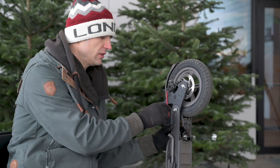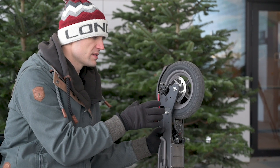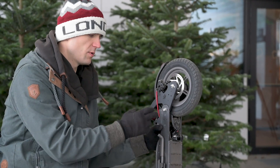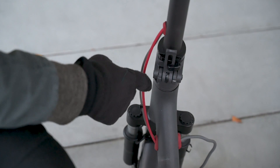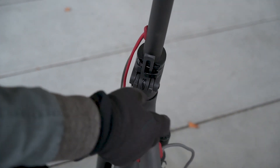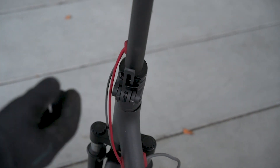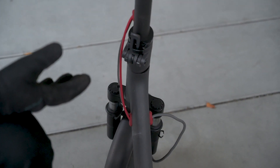Another downside — I don't like how this cable is now. While I made the rear brakes work and nothing is touching, I feel that this cable is really stretched both here and at the front of the scooter. You can see the brake cable is really stretched here, and if I turn right all the way it kind of pulls on the brakes at the back. So it's another issue — you basically need a longer brake hose, a longer brake cable.